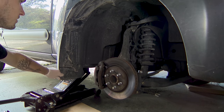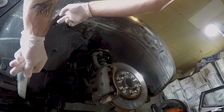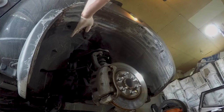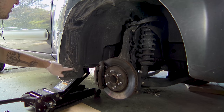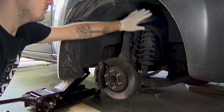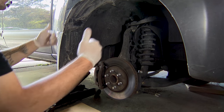That will include taking off the mud guard and all the screws around the rim of the wheel well. On the interior it's just going to be body panel clips, but on the outside they're actual screws. So just take a look around, follow the edge, take out each screw that you see, take out the interior body clips, and then pull the entire wheel well out.